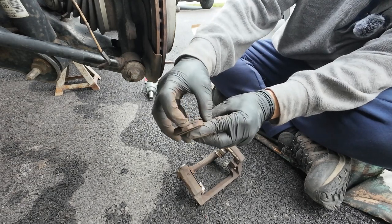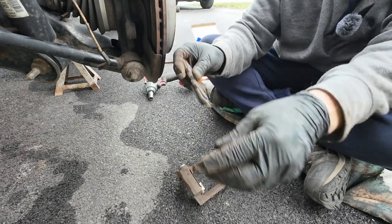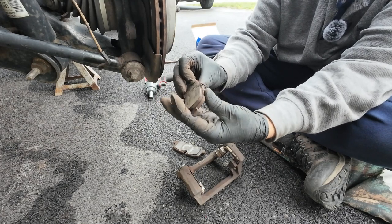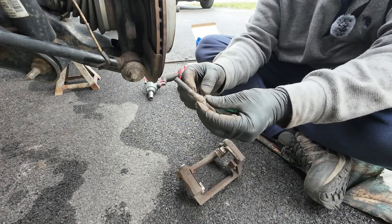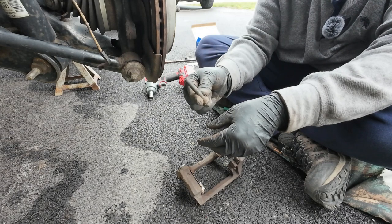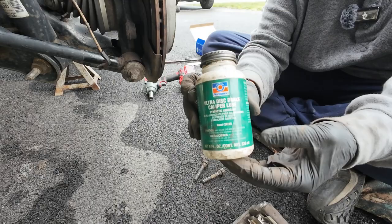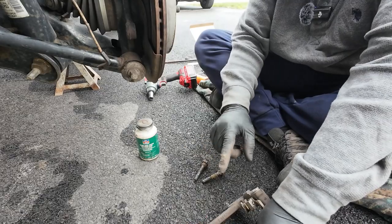These are bad. See how they're coming apart right there? I don't know what brake pads these are — there's no name on them. These are probably something the dealer put on. I've been complaining about the dealer's choice of using copper grease. Copper anti-seize is not what you want to use for this; it needs to move in and out. Copper anti-seize does not work. This is the stuff I use for brake pins — use this stuff. This is one of the reasons why you should be doing your own brakes, so you can catch things like this.